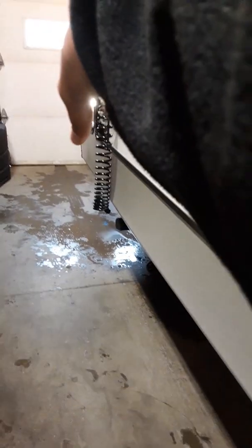All right. Now I'm just trying to figure out when I would need to pull those levers. Let's say I'm on the beach, and I've hooked up my hose to that tank flush, and now I'm pumping water through it. It's supposed to come out through there. Do I need to pull the levers to make that happen? Yeah, they open up the valves. If you leave them closed, it's just going to fill more water in the tanks, and it'll end up coming out of the drains from inside because you're filling it all the way to the top.